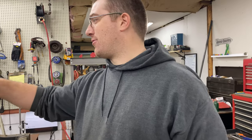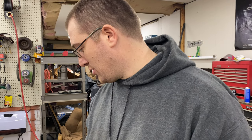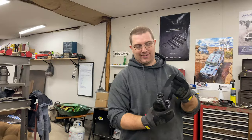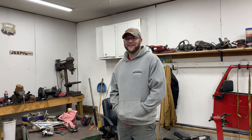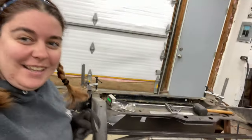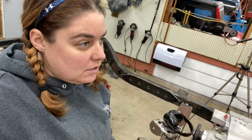We finished up the rear mounts - they're mounted. We took a measurement and to get our 25% separation of tire size for the axle link mounts, we have to extend these about an inch. We've got them marked out so I'm going to take the plasma and cut them. We've got the lower joints, the tabs hold it on, and they haven't fallen off yet so apparently my tacks are holding. We widened the holes for these brackets because they weren't big enough. We'll have to do the same with the uppers, but we're not there yet.